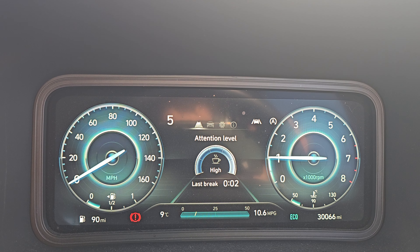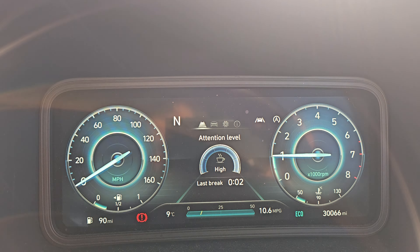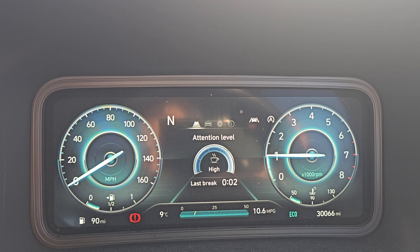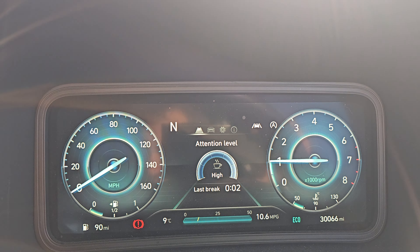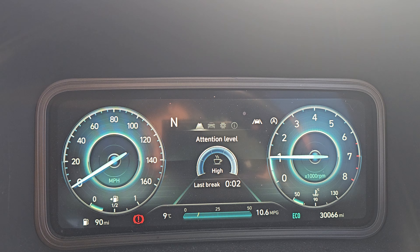Four, five, and six — so all gears are now learned. For some reason you have to do this if you replace the clutch fluid on it, because it's an Intelligent Manual Transmission and has sailing mode and other features. Every time you replace the clutch fluid and need to bleed it, you can end up with that light flashing.